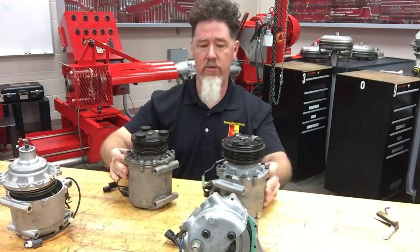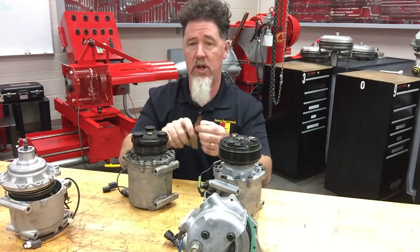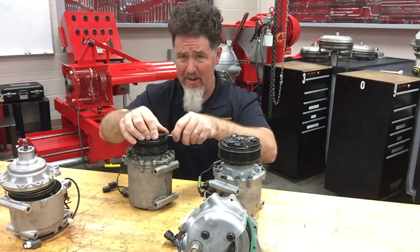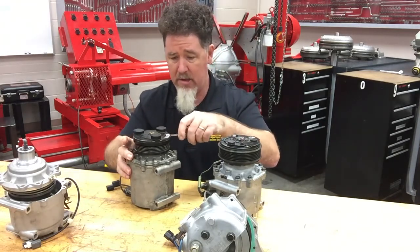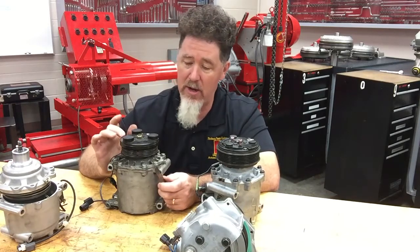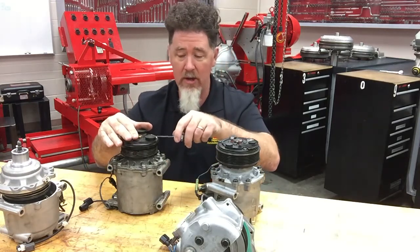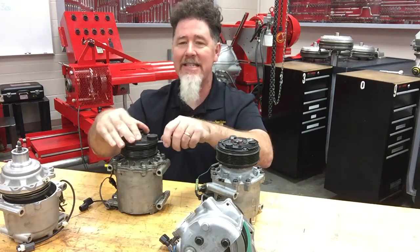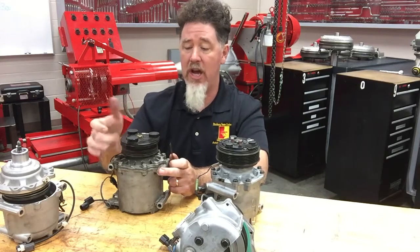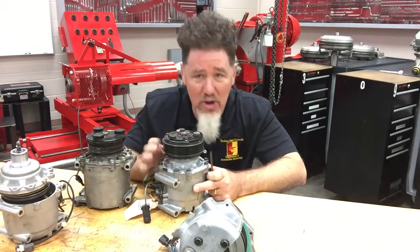Let me take a look at both of these compressors. This first one spins really nice — I'm doing an inspection of the pulley, it spins around really well. I'm going to take a feeler gauge and measure the clutch clearance. I've got a 15 thousandths in there right now — that's probably right at the low end of spec. If I was measuring it I would look up the spec for the vehicle, which could be 18 to 25, or 14 to 21. Fifteen seems a little tight but the bearing doesn't seem to be dragging on the hub at all.